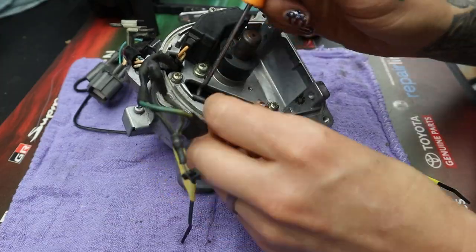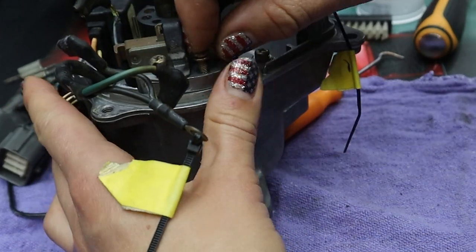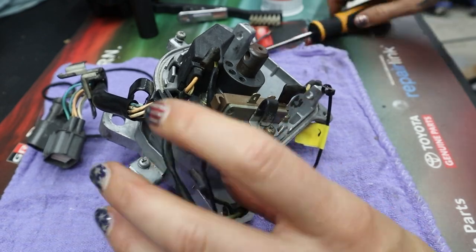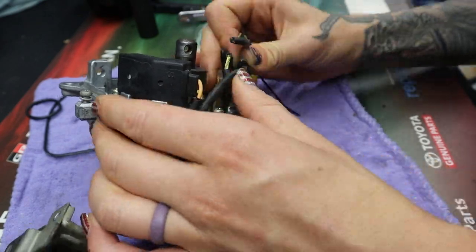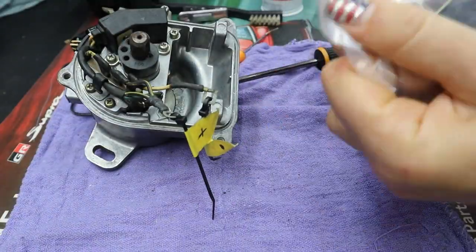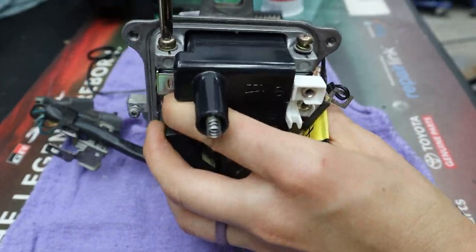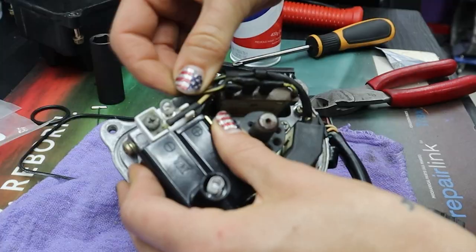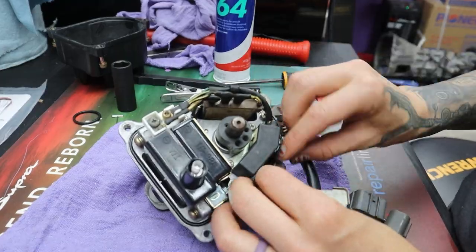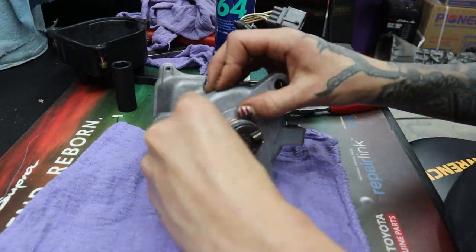Next I'm going to install the igniter. I'll first feed the wire through this opening with my 90-degree pick, then install the igniter with the two screws — making sure not to forget that one of these has that little wire holding clip with it. You can see me plug in the wire harness in the proper positions on the igniter. The coil was not good so here's my brand new OEM Honda coil that I found on eBay. Installing it with these two longer Phillips screws, then connecting the positive and the negative wires to the coil. Now here's my new distributor cap seal, so I'm going to fit that into the groove in the distributor housing body.